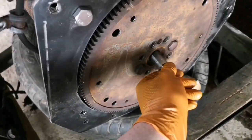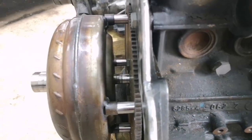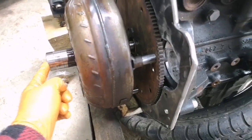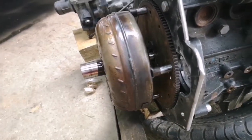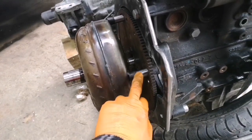That is a decent fit there. Bolted it all up — happy with it. That all lines up like it should. Measured it, and I needed less than 192mm from the end of the oil pump drive to the mating face of the bell housing. And I'm at 191mm. So happy with that. Going to thread lock these together.